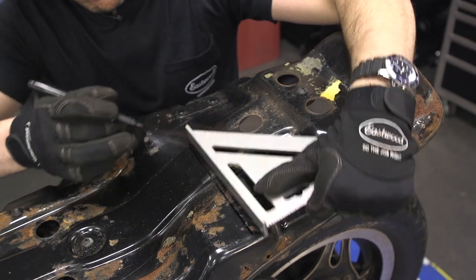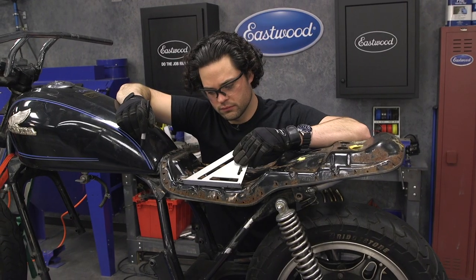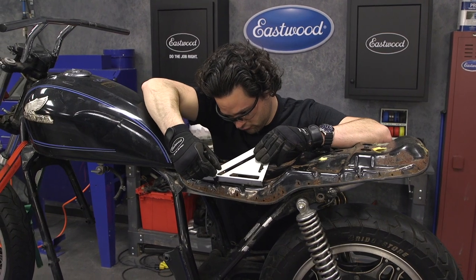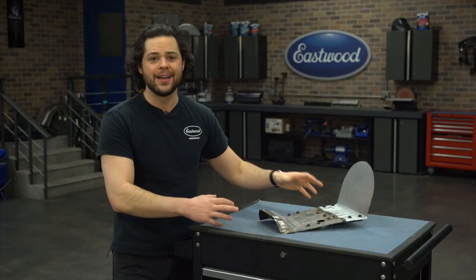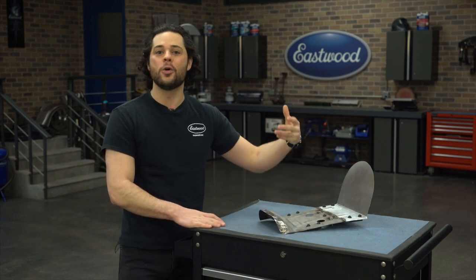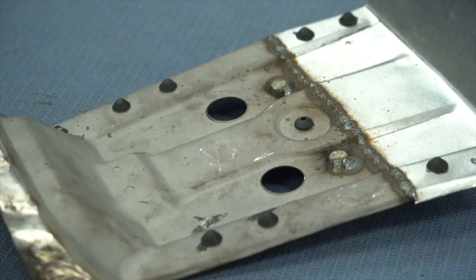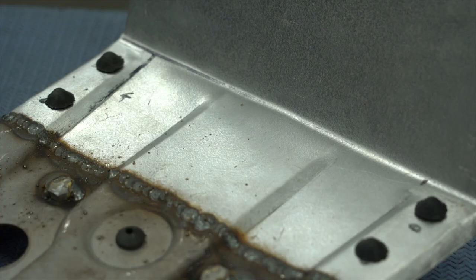But I didn't like the huge factory pillion section — the rear part of the seat. I didn't like that it had mounting hardware all the way back near the pillion seat. So I thought to myself: I like the front, but I don't like the back. I'll cut the rear pan off, keep all the good features on the front, and remake the rear pan on my own. The only problem was the pan was stamped and has a little bit of a weird step shape in the middle because of that stamping. But with some clever planning and a little focus, I bet I could get a piece of sheet metal to that shape with nothing but the offset dies and the bead roller.